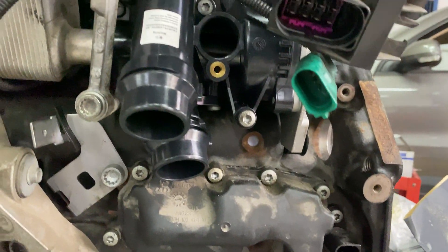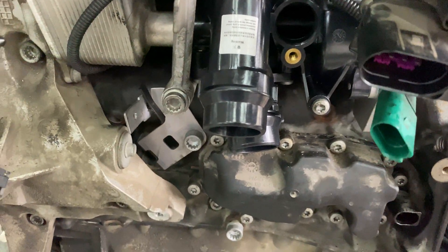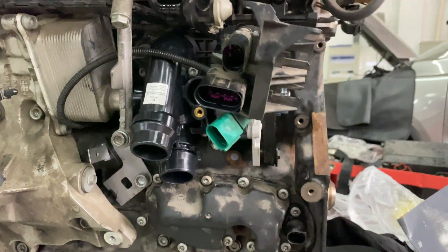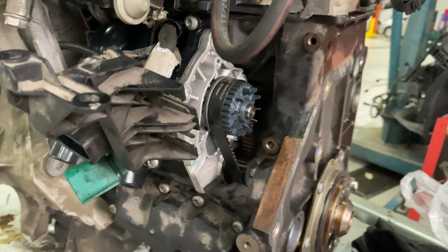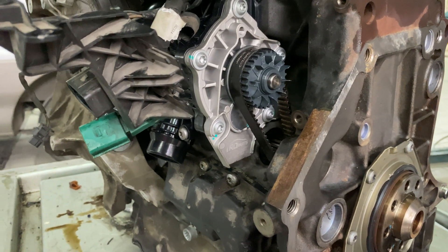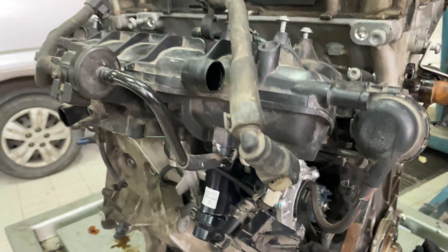So intake, and then with higher pressure the fluid comes out. I just want to give you an idea where this is, what to look for, and how it's mounted and driven. So it is a belt — if that's the question and that's what you're looking for, there's the answer. It's not on the front of the engine; it's actually right on the side underneath the intake manifold.